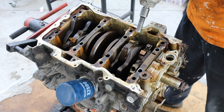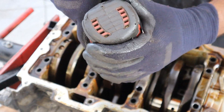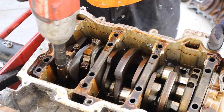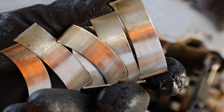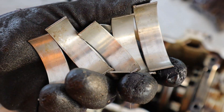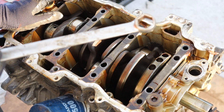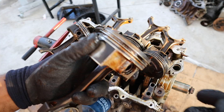These are actually 11mm bolts — until now I've never actually used my 11mm socket. So now that we know what the oil pan looks like, these bearings don't look too bad. There are a few lines on this bearing over here, but overall it's in decent shape. Now I'm just going to use my piston removal tool and push down on these connecting rods so we can get them out of the block. Taking a look at the piston.